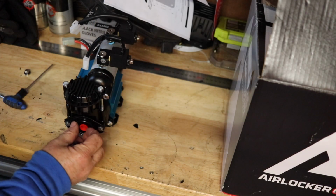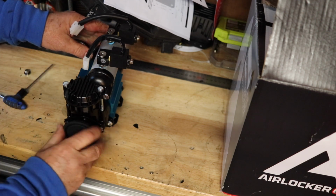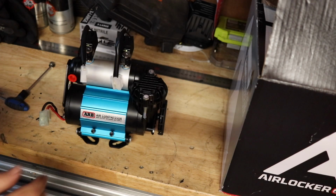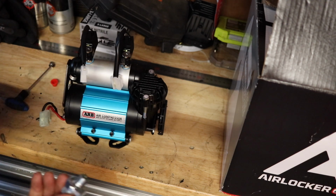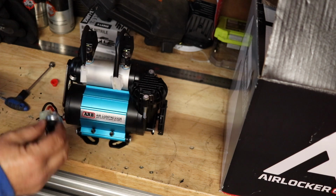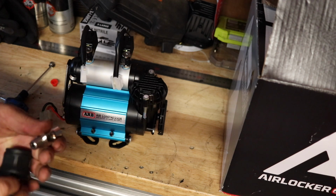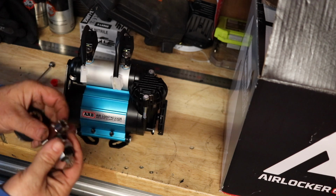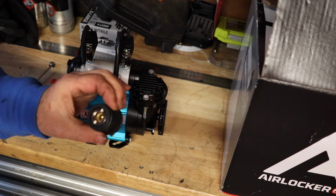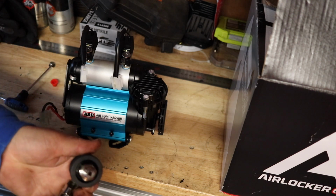Now, if those fitted, the air cleaner, you just pull out the plug, screw this in. That's done. Now, the last piece that needs to be added is to pull this plastic bung out. And if you weren't going to use this to pump up your tyres, you just put a pressure switch with a bit of Teflon tape into here. However, because we're going to pump up our tyres in the air hose kit, you get a T-junction, the pressure switch goes into one side, and a female air connection goes into the top. But we'll put some Teflon tape on all of that and install it.